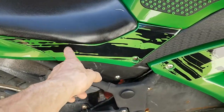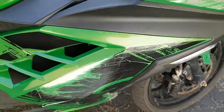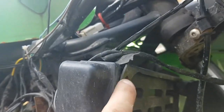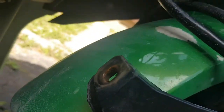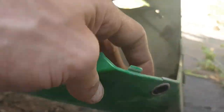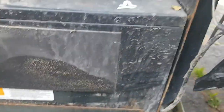In my last video I showed how to take these two pieces off, so I'm gonna take those off and then take this big panel off here. If you look up under here, there's a screw mount that basically holds that whole side panel onto the bike — you gotta remove that. Then there's another screw right here, and a couple of side panel fairing screws that gotta come out. Then you gotta take this screw off down here so the panel slips out.